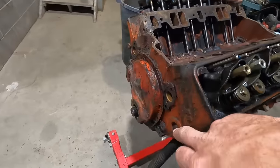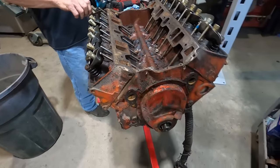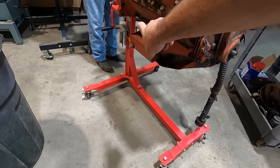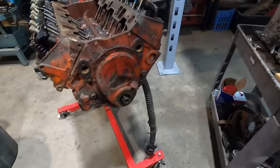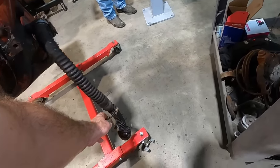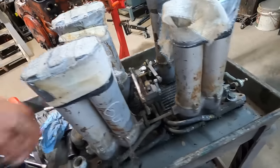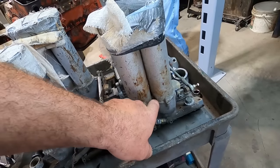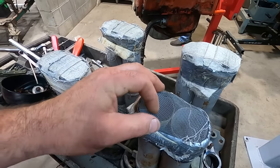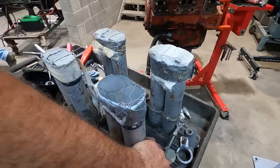Another thing, these are early heads, so they don't have the accessory holes in them. Man, it's got the finned aluminum block off plate. Somebody modified a stock oil pan for, I suppose, more capacity. And then they got this flexi hose road draft tube thing. Look, dual flexi hoses. What a deal. And then obviously it was leaking around the air horns at one point, so they silicone that all up. Classy. But they did put some screen over the tubes.